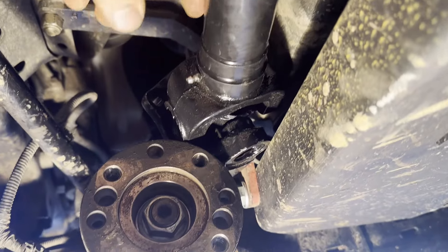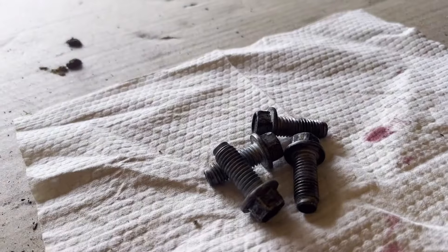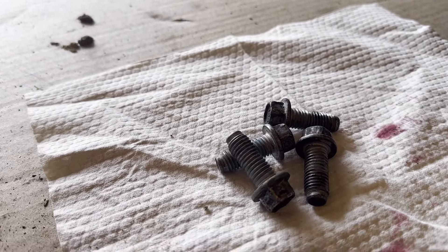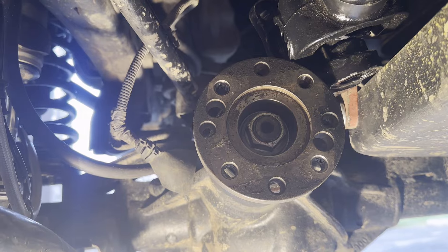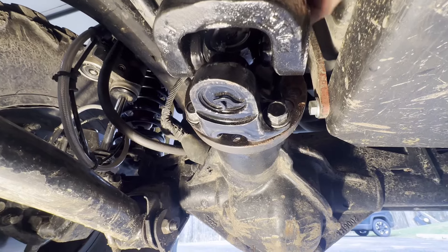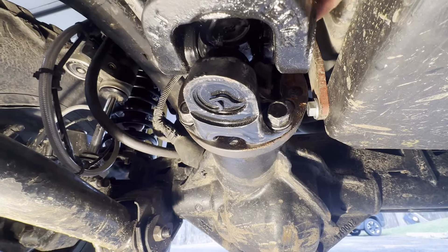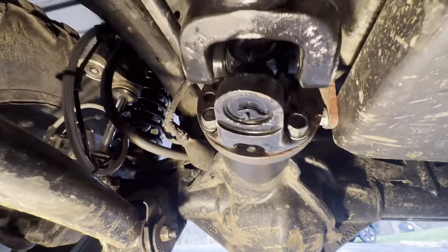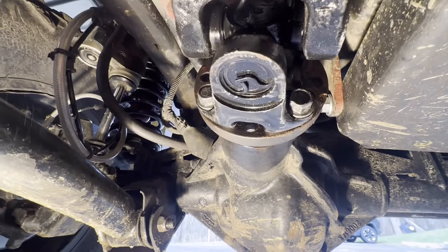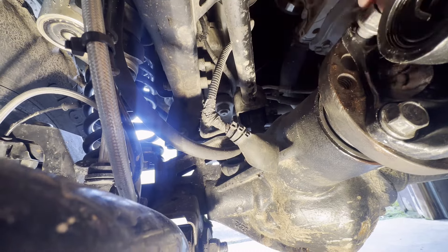The front of the drive shaft is resting up there. I'm going to compress the slip yoke, line it up to the flange, and use the existing stock 15-millimeter head bolts with blue Loctite. Adams says to torque them to 80 foot-pounds. Getting all four bolts started — no problem, lining up nice with blue Loctite. I'll lift up the front end so I can rotate the drive shaft and tighten them up and get them torqued.